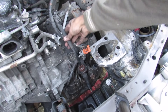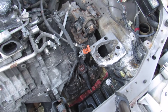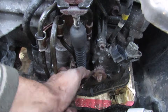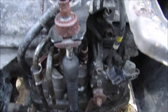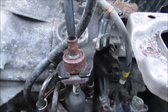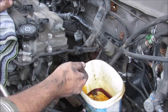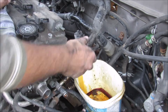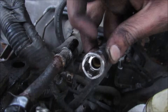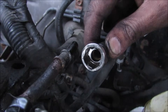There are two main cables that go to the transmission: the shift cable and the throttle cable. The throttle cable was connected to the throttle body. Here's a closer look at the shift cable — I've already disconnected it; this is the lever that changes the gears. Over here we've got the bracket with two 14mm bolts that hold this cable onto the transmission. Next I'm going to remove the fuel line — it goes to the fuel rail. The inside of this fuel line has four little tabs that I pressed down with a screwdriver and I was able to pull it out. There is a special tool you can get to do this easier.